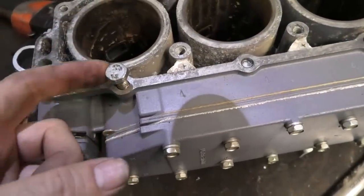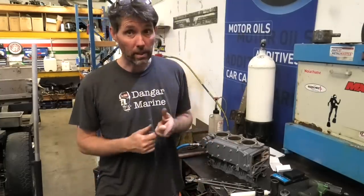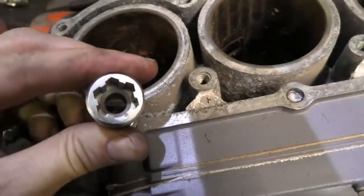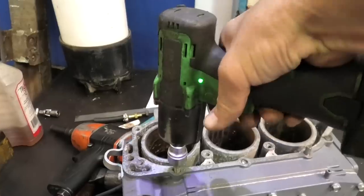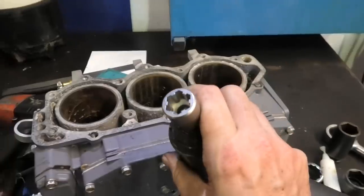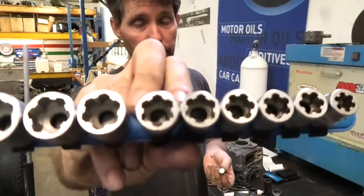To complete our set I've put this one in and rounded off the hex on a grinder, and this one we've cut pretty much flush. I'll start here on the bolt with the rounded head. Technically it's a broken bolt, but as I was saying with the shank where we can get vice grips on, another option with heads that are rounded off is you can get sockets that are designed to grip onto them. You'll find that when you put it on, as it turns it really bites into it quite well and then with a gun or a hand ratchet you wind it out. These sockets work really well — a set of these for removing rounded-off heads is a really worthwhile investment.